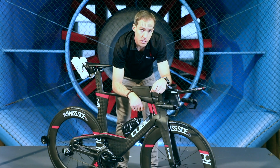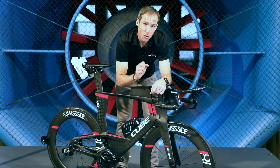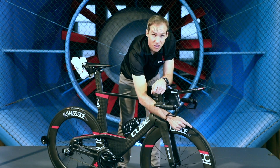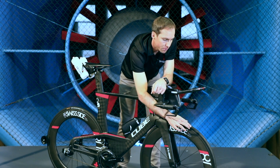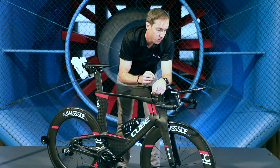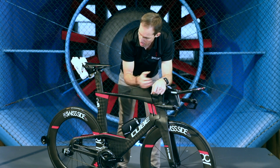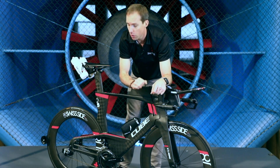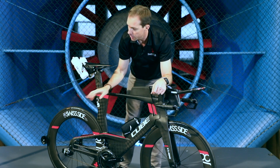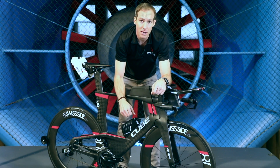So when making your tyre choice, remember: to get the most out of the aerodynamics of your front wheel, you need a tyre with sidewall tread on the upper sidewall section. We recommend a 23mm tyre to maximise aero performance. For the rear, you don't need to worry about aero, so you can focus simply on rolling resistance — there we recommend a 25mm tyre.